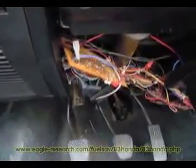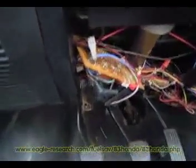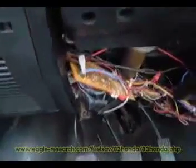One additional thing: I've tied into the choke so that if the choke is activated, it also allows the fuel to flow, because activating the choke advances the throttle and allows the engine to run at a higher RPM. With those inputs, the RPM fuel shutoff works just fine. Now we'll take a quick look under the hood to see the actual fuel savers.